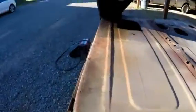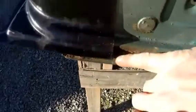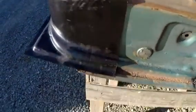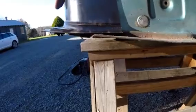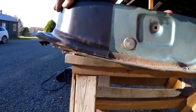So look, if there's still some of the door like this left, set this piece in here, especially if you have any of this outside where you can get this lip right and get the angle right. Then scribe this line all the way through here where you're going to be cutting. But make sure to get a line down here so when you put this back in, you know where this angle is, because if you put this back in like this, you're going to run into the problem I had on that other door. It needs to be like that.